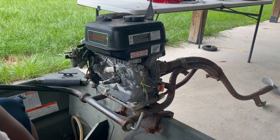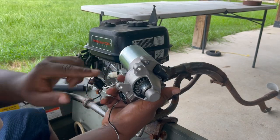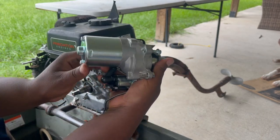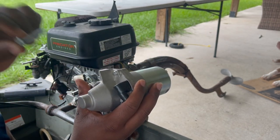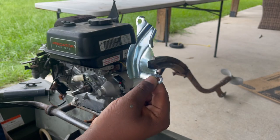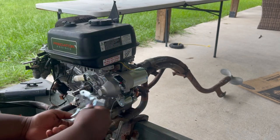So we're going to put the charging coil in with two little screw ends — it's definitely in there, not going anywhere. Now we're going to install the starter solenoid, facing right here, going in just like this. You have a long bolt and a shorter screw. This is the other shroud we're going to be using — we threw the old one away. This one is nice and shiny, so I'm going to put that on there.